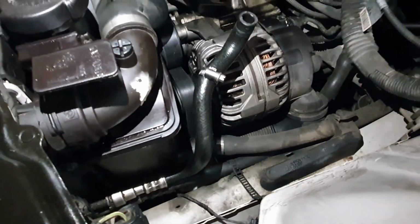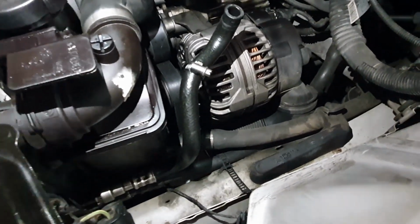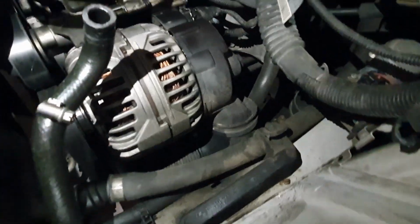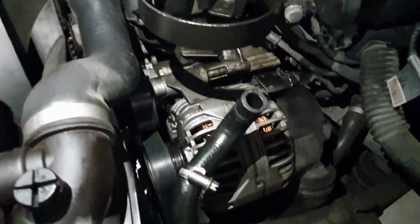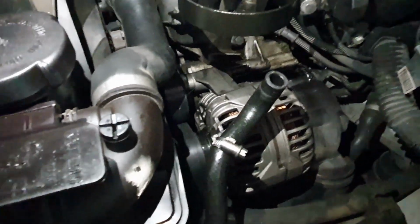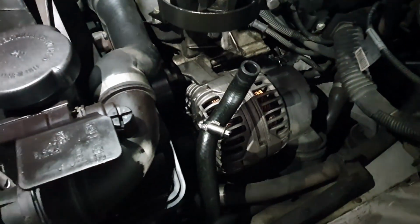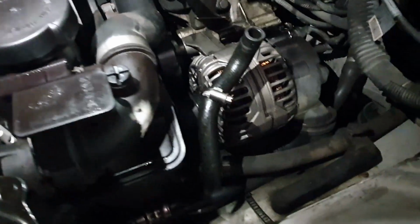It looks okay. So what I'm going to do is get the hose that feeds down there, connect it on the bottom and do it up, then pop the reservoir into that one and then into this hose, and pretty much put everything back together, bleed the system, and hope that it doesn't leak anymore.